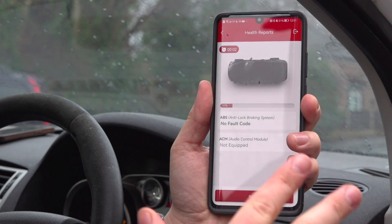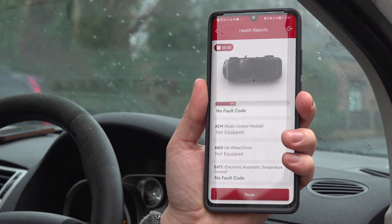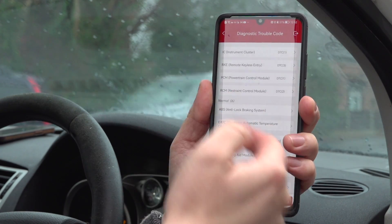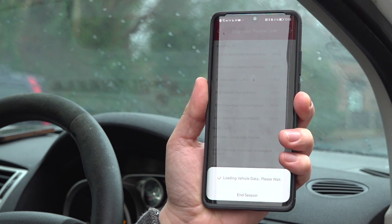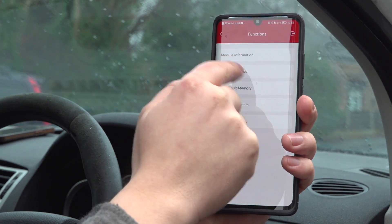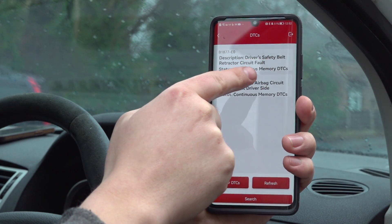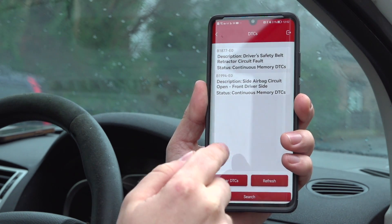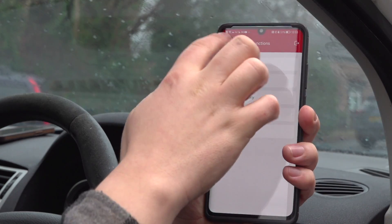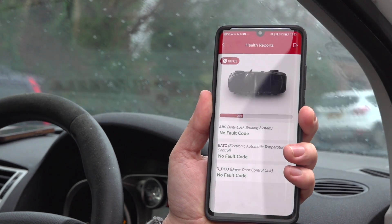I just need to click the health report up here, and it's going to perform a full diagnostic of the car and come up with any fault codes for the modules that are installed on it. Here's our list of fault codes — we've got six fault codes in these modules, and the rest are all okay. If I go into the restraint module, I know exactly what this is. I had the front seat out when I was cleaning it — sure enough it comes up as the driver's safety belt and side airbag circuit. So let's clear these fault codes, and I'll clear all of them and see which ones come back.